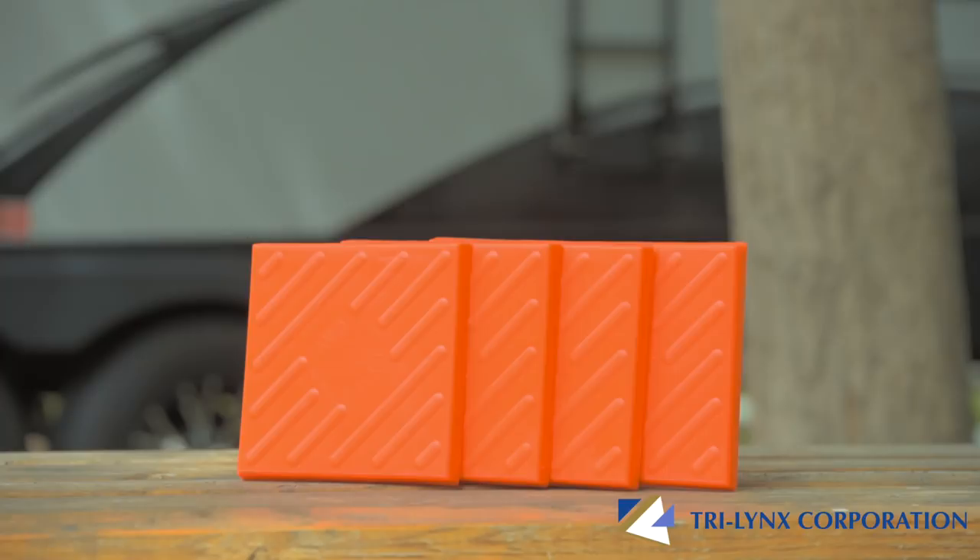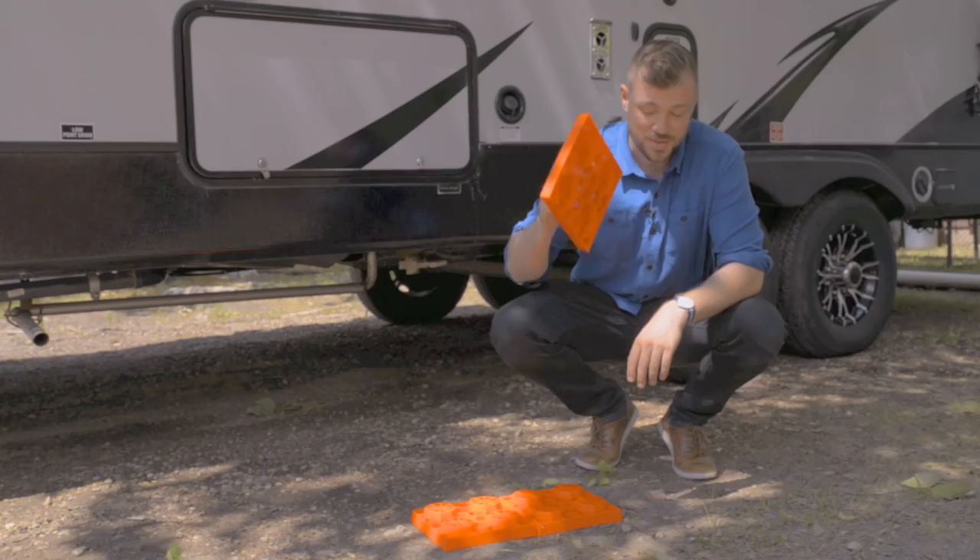You've found a site. It's nice solid ground and level but not perfect. More often than not you're going to have to raise a wheel or two. One block is going to raise your RV by one inch, but for a two-inch raise we're going to have to build a pyramid with three blocks. We're going to start with the two-inch raise as the same principles apply — it's just a bit trickier.